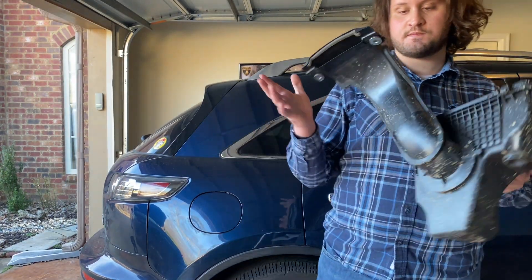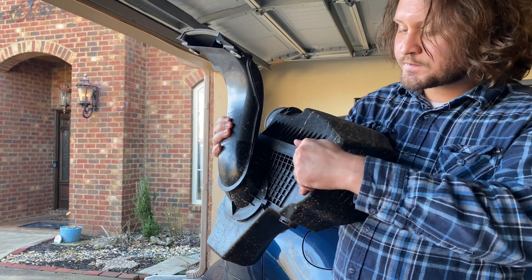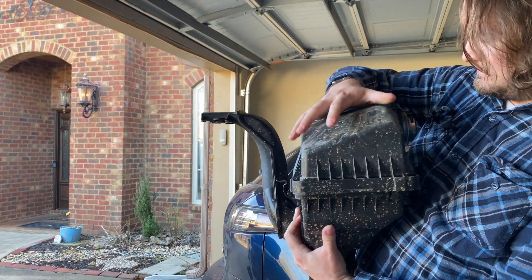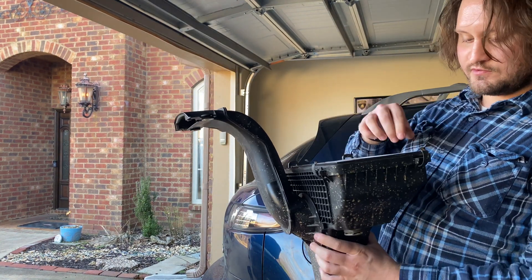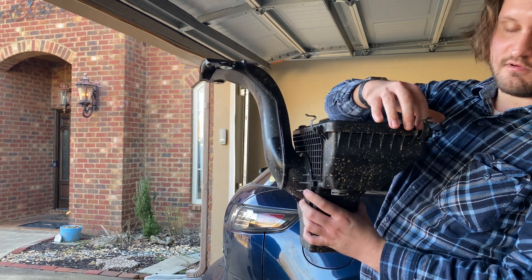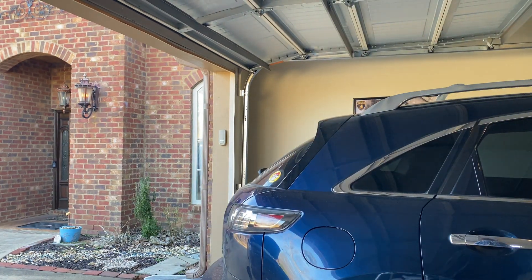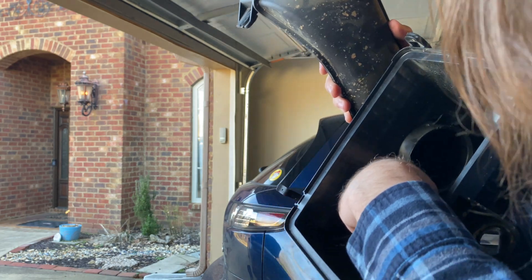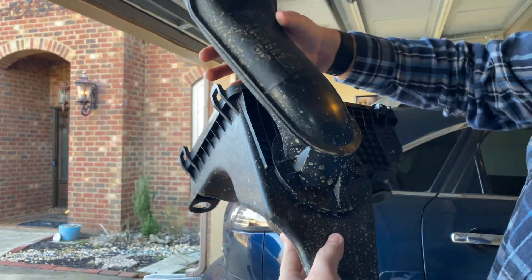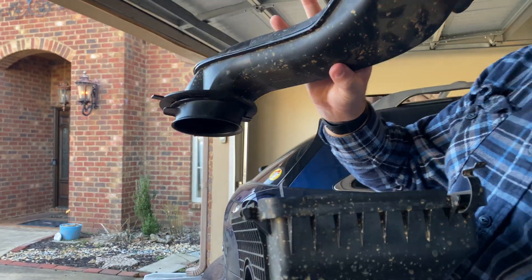One of the first things we're going to need is a piece from the factory airbox. With the assembled box, we're going to undo this latch and this latch, then lift and pull off the top, revealing our filter. If the filter is stuck, you can get it out with a flathead by pushing in right under this clip until it pulls up. That leaves us with an open box where it has the ability to twist. In order to twist it, we're locked right here, so we're going to lift that over that little lock and twist it until that part comes off.